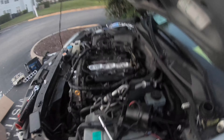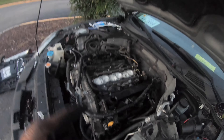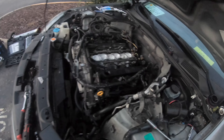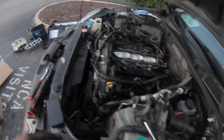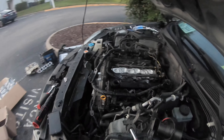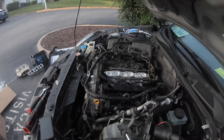I'm actually losing daylight because of this stupid valve cover — I lost one of the bolts so I might end up having a leak unless I find one. I've got extra bolts lying around somewhere. The CNC ported lower intake manifold is in and the injectors are all torqued down. I had to do the valve covers because valve cover number six was leaking oil into the spark plug well. It took me forever — my brother had to bring me a swivel ratchet to get to the last bolt. I would have been done hours ago.